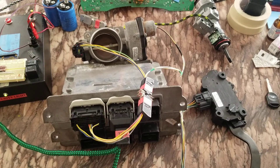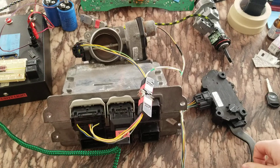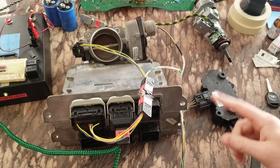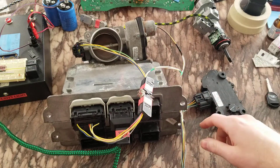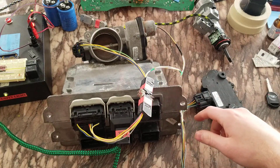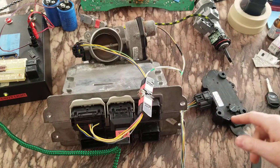What we got today is a few parts out of a 2008 Ford Explorer Sport Trac. The customer was having a problem with their throttle body - their throttle doesn't open was the issue. So what I've got is the pedal position sensor, throttle body, and it's drive-by-wire.